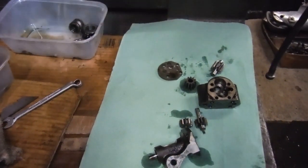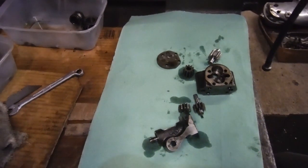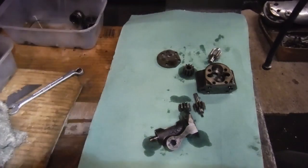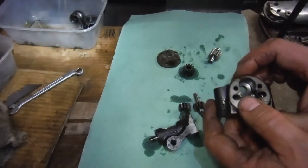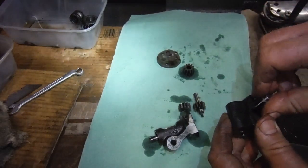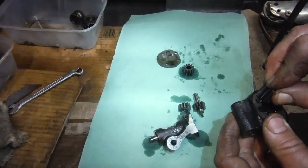It's a cast iron type, and the very fact that someone must have taken it upon themselves to fit an oil tap would be to prevent wet sumping, which would suggest to me a worn oil pump. And sure enough, it's not damaged — let's not confuse wear with damage — but there's a bit of play.